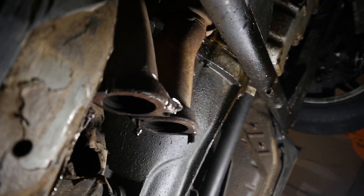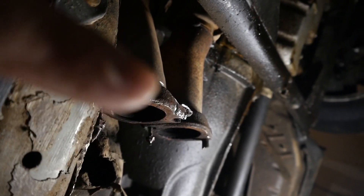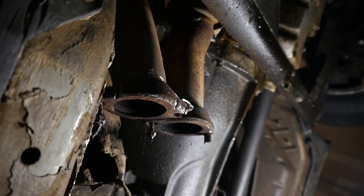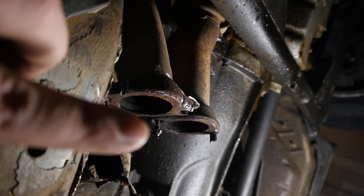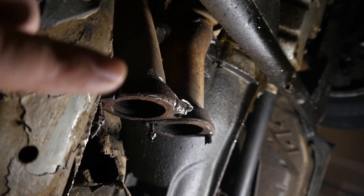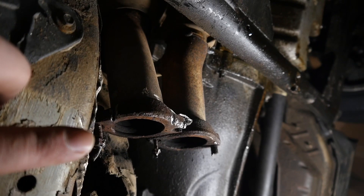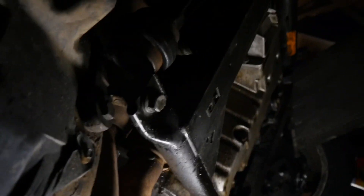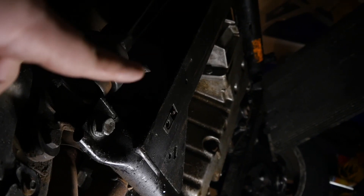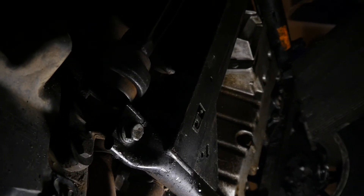After some fighting — actually quite a lot of fighting — I have finally gotten the exhaust off. I started off by trying to cut the little screw hole out, that didn't work. I ended up cutting one bolt right there at the nut. This bolt here just kind of pulled through because it's so rusted and tiny I was able to pull it through the hole. That one I cut out the side and slid the bolt out. The nut had become so small I pried with a lot of force and eventually was able to pull the bolt through the clamp. So now that that's out, I've got to work on the motor mount and there are a few other little electronic bits to undo, but pretty much this thing is almost ready to go.